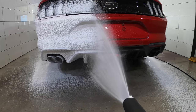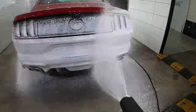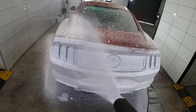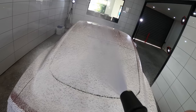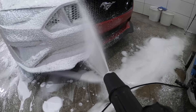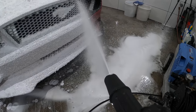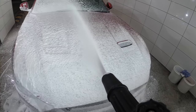but back when I was doing mobile detailing, I tend to give it 3 to 5 minutes and then reapply the foam and let it sit again for a few more minutes. The best way to think about a pre-soak foam is about soaking parts or even your dishes before washing them. It doesn't negate the fact that you still need to wash the car, but that good long pre-soak really helps lift more grime off the vehicle in a much safer and more effective way.